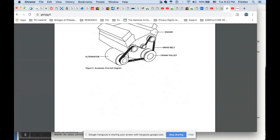And now it does, this is not for free. This generator actually is a drag on the engine. So if you use a bigger generator, the internal components just don't turn easily. If you put your hand on that and try to spin it, it requires a significant amount of torque to rotate it with your hand. That hand action comes from this guy now, the engine.